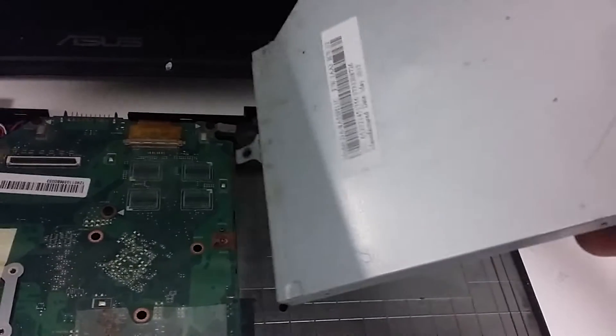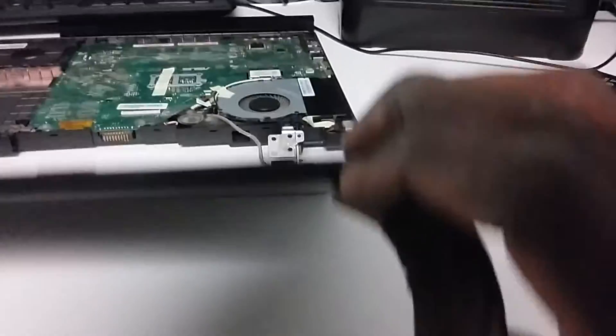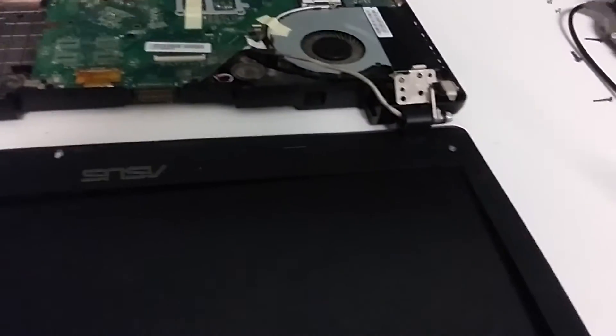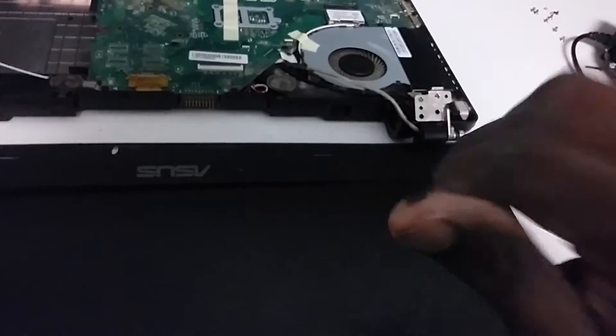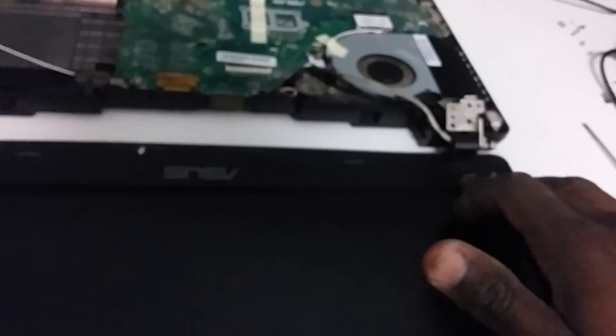Now that I'm exposed to the screen, I'm using my nails to get through these clips — I don't want to use the flat head because it may do real damage to the screen. After getting the clips off, there are two little screws holding this bottom part. You can't see them right away because there's a little dark piece blocking the screws — use something pointed to get under it, take it off, and then the screws are exposed.